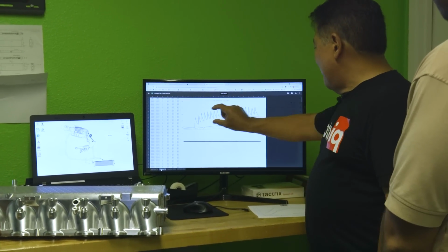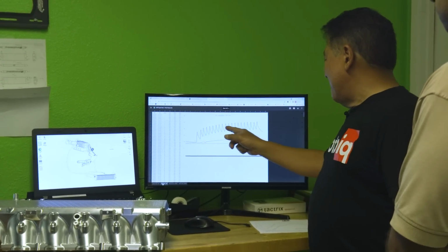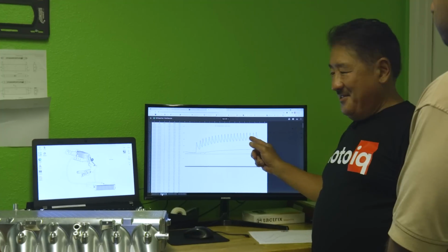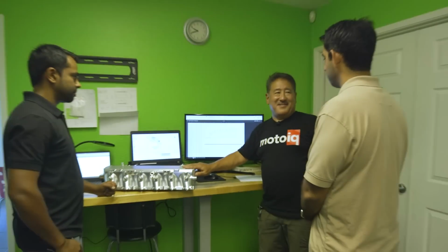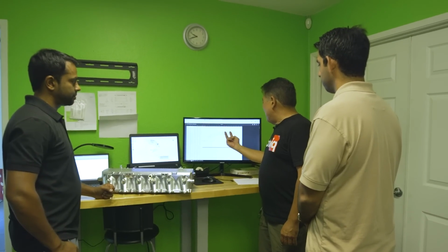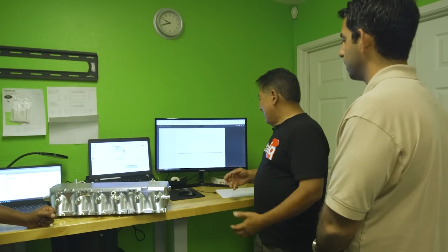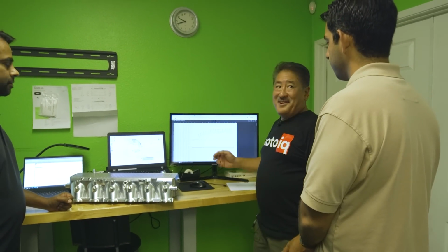The CSF core temperature is much more consistent from the first runs to when you achieve saturation. That's because the thermal capacity of the core is more. These are more narrow, so it's rejecting heat quicker. Overall, it's much better, very impressive.